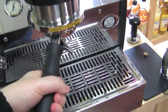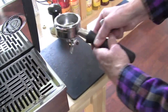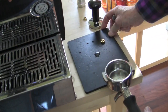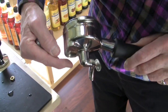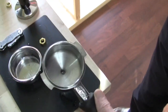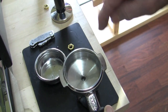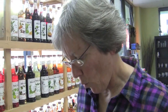Stainless steel innards in this machine. Now, the portafilter — notice the angle of the handle. That's so that when you put it down to tamp, it's actually flat. It has breakaway spouts — these pop right off and it's hard to get back on. There's the flat area for tamping. This is also a stainless steel portafilter. Versus the chrome-plated brass, eventually the chrome plating comes off and you have brass under there which collects more residual coffee and the taste stays. It doesn't stick to the stainless the same way, so you can just wipe it away.